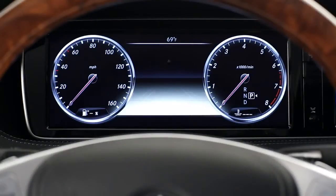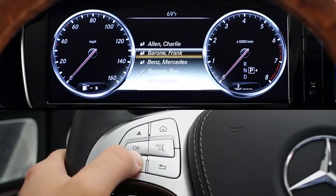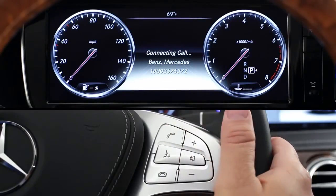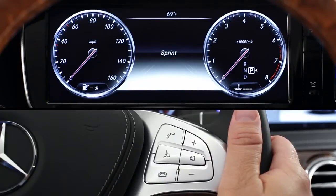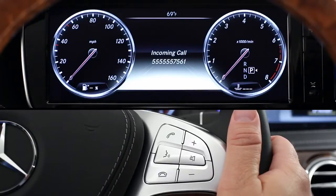The telephone menu operates your Bluetooth paired phone. To learn how to pair a phone, please see your operator's manual. You'll see 'Phone Ready' on the screen if the phone is already paired, or sometimes you'll see the phone's name or your wireless provider's. To place a call from your phone book, use the arrow keys to scroll until you locate that entry. Then use the send and end phone buttons to dial the call and to hang up when you're finished. If you receive an incoming call, the caller ID information appears on the screen automatically. Use the send and end buttons to accept or reject the call.